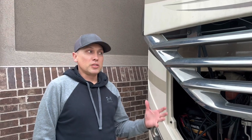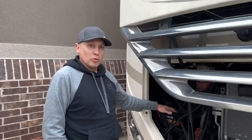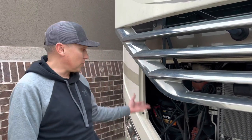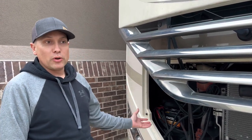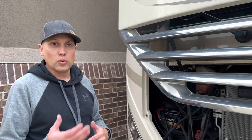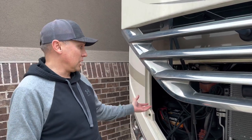That's how we changed the battery in this coach — it's actually a pretty simple battery change. Of all the batteries I've done on any car, this is probably the easiest. It's just an 8mm and 10mm bolt to get the cables off and pop the new one in. Remember to take the old battery to the auto parts store for the core exchange — the core charge is usually $10 to $20, and if you don't have an old battery to turn in, they charge that extra on top.